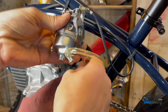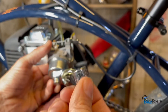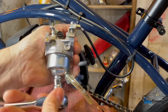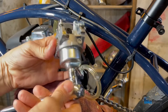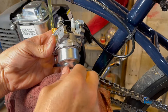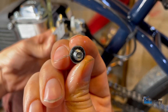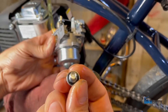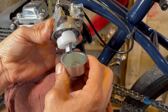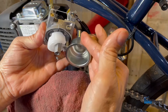Let's go deeper. I'll just take a shop rag — a 10 millimeter fits on the bottom of that. It's probably going to leak everywhere because it's full of fuel from my testing. You can see there's a little rubber o-ring on there — pay attention to that, make sure it's okay. Take your bowl off. There's some fuel in there; I'll dump it out through the bottom.